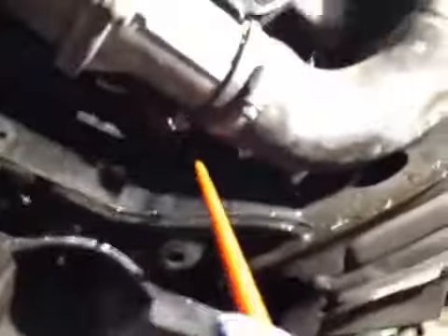It's pretty hard to see, but the orange speck up there — a bit further up — your coolant header tank is leaking and requires replacing. As you can see, there's coolant all around here, and it's been leaking over a period of time.